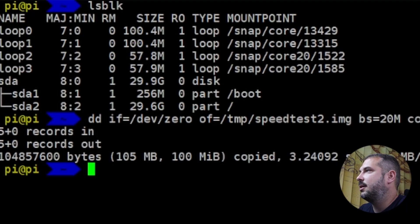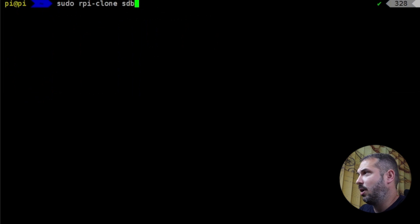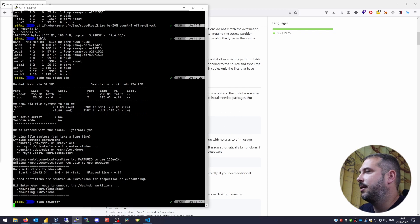But we're only halfway through. We want to use an SSD — solid state drive — in our Pi. We'll attach it to the Raspberry Pi in a USB case and migrate our Pi once again. Run lsblk to see devices, then attach your SSD drive in its USB case to the Raspberry Pi and run lsblk again. You'll see a new drive named sdb. Run: sudo rpi-clone sdb, confirm the questions, and the migration is done. Then run sudo poweroff, disconnect the power supply, detach the USB thumb drive, and leave only the SSD drive connected.